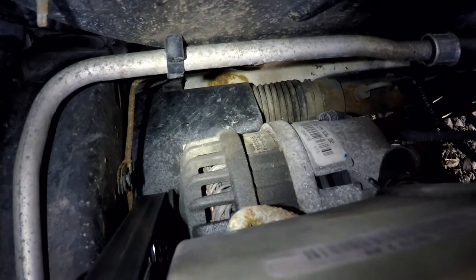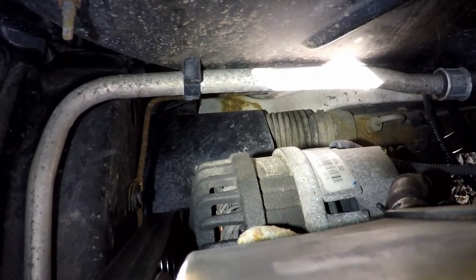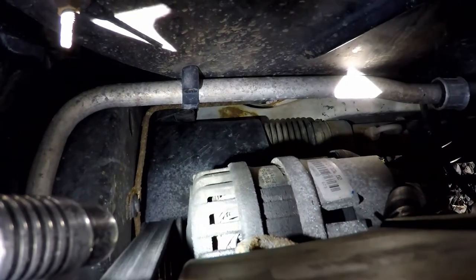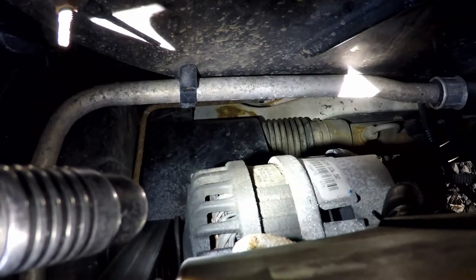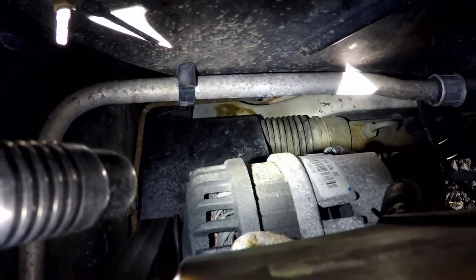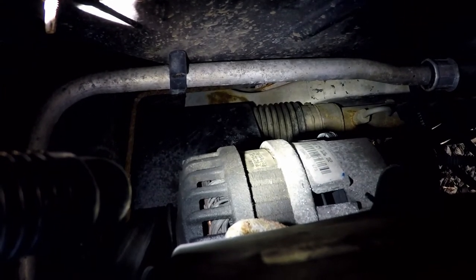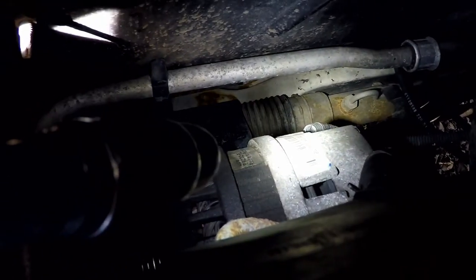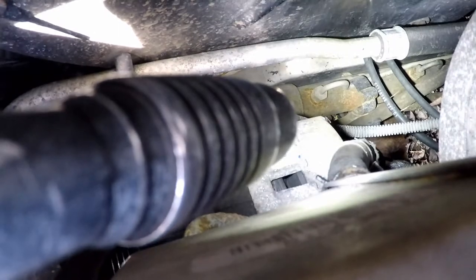Typically your alternator is going to be an aluminum housing device. Usually it has these fins here that allow air into it. There is this black section here that looks like it's kind of segmented. That is the outside, cooled portion of our stator. Then we have a back cap area, and then we have connections typically across the back.